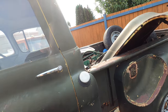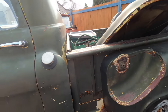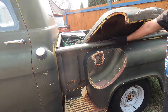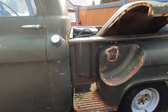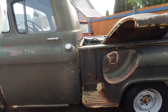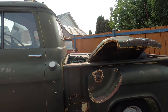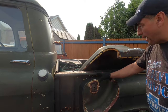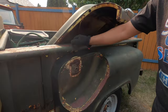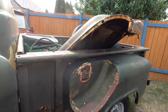What about this bed — is this a good one, a bad one, or a rough one? Typically you'd want to dig it out and have a good look inside. You want to see how straight the box rails are. When building this truck, the cab is the biggest focus — the box is hit or miss. You'll either have a really good box or one you have to piece together, but the parts are available so it's not the end of the world. You can see this one originally had a spare tire mounting bracket, and a lot of guys like to restore it with the bracket or they take it out and put a patch in.